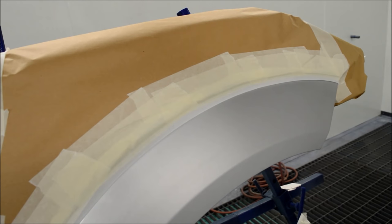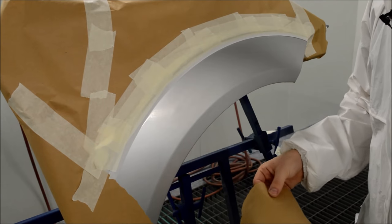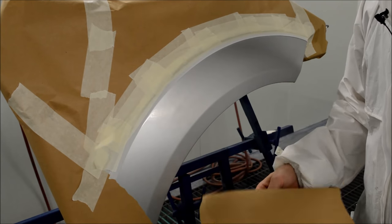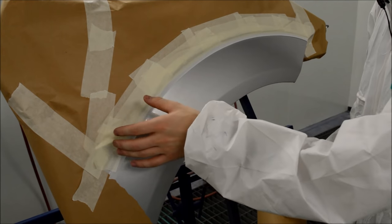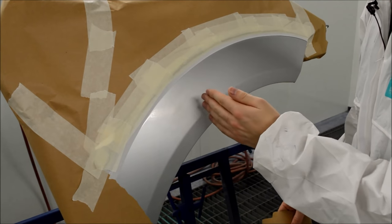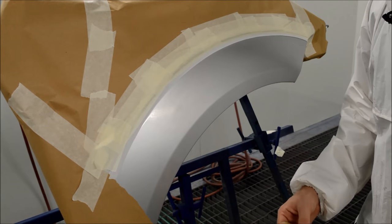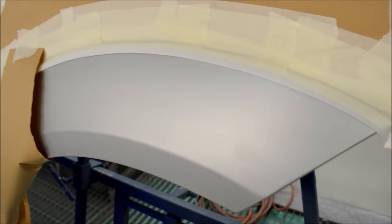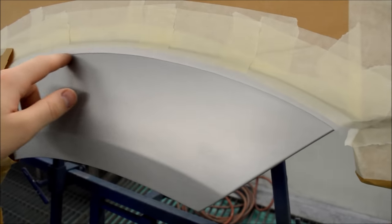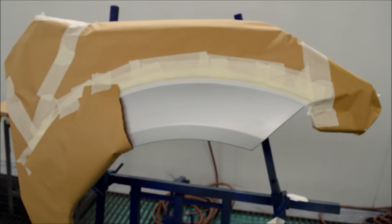The blending tape is applied. Now we need to sort out where we're going to do our fade out with the lacquer. I've got three little bits of brown paper that we're going to apply to form a tunnel shape — one, two, and three — which will allow us to do our fade out in a step-by-step process using our fade out thinners. This is the full job all masked up and ready to go, with our J-tape's no-edge blending foam on there and our tunnels set up for the fade out. We're all ready for paint.